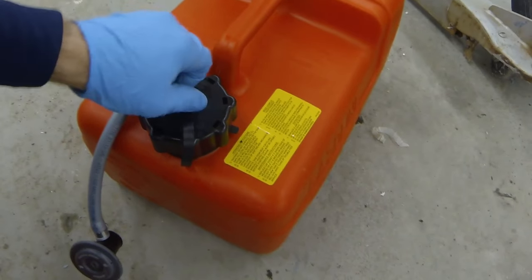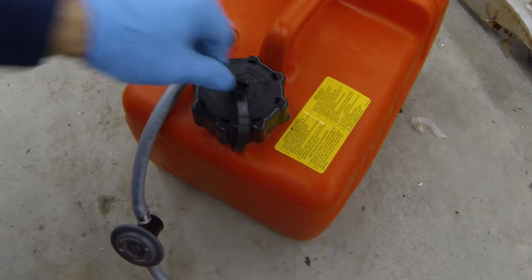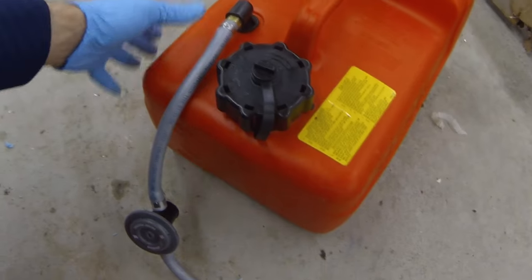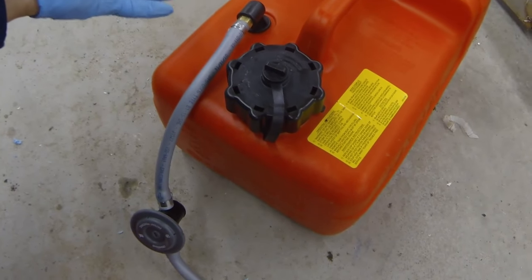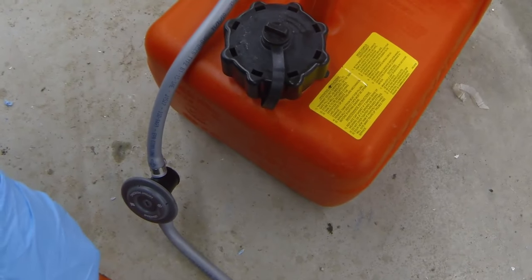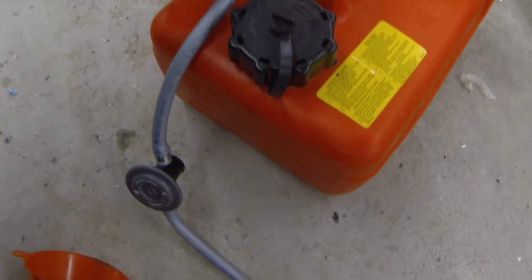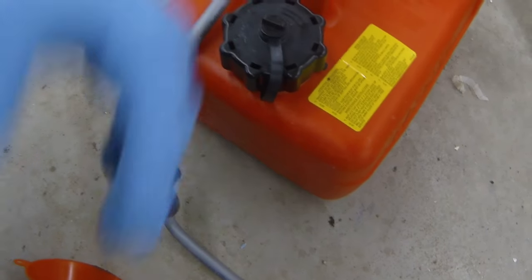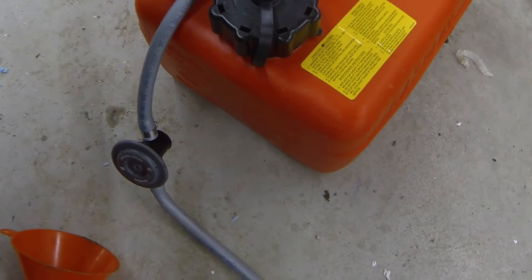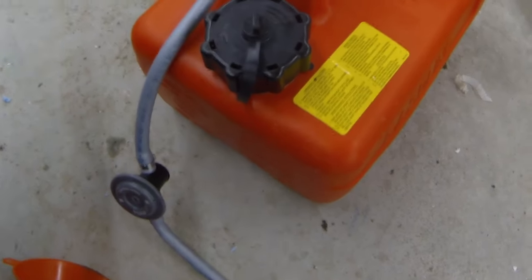Once we get our gas cap on there tight, undo our vent cap. By undoing that little vent cap, we're going to allow air to flow back into the tank as the gasoline is taken out by the motor, otherwise you get negative pressure. It's not too uncommon to see boats going down the river and the motor stop working because someone forgot to open up this vent cap — air not being allowed to get back in, and the gas tank just gets squeezed all the way down from that negative pressure. So open that up, and at the end of practice make sure you close it so nothing leaks out.